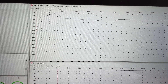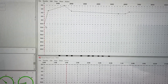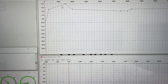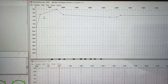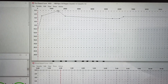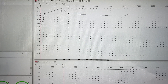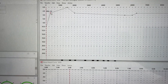This is going to look confusing, so let me explain. Remember, it can only retard — it can't add timing. So you need a little math to figure this out. If I do zero retard, timing is at 38 degrees. At zero RPM from the start, I have it take out 10 degrees, so technically it's at 28 degrees as soon as it starts cranking. That's my start retard — it's easier on the starter to get it rolling. Then it starts ramping up. I idle at 1500, so I wanted to keep adding timing as it ramps up — it gets to RPM easier that way.